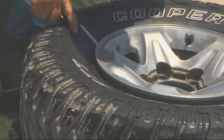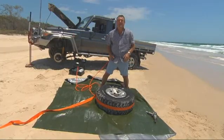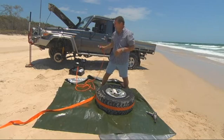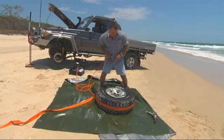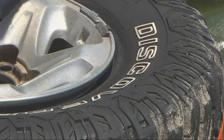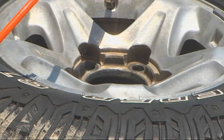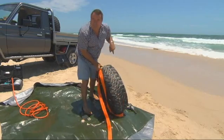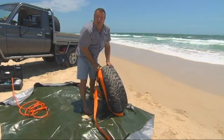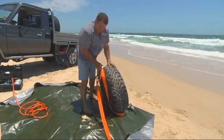If you like, you can get on YouTube and watch guys exploding their tyres onto the rim. We don't need to do that. We've got a great air compressor, and importantly, we've got the tank for the whoosh of air. And with an output of 132 litres a minute under load, it doesn't take long for it to do the trick. What the strap does for us is actually push the bead against the rim and help with the seal. And once it starts to seal, your job's done.